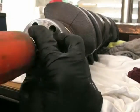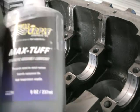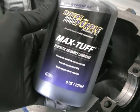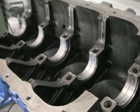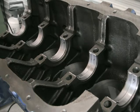At the end of the crank there's a little bearing — it's a 6001 bearing. You may as well change this one while you're in here. It's what the gearbox shaft sits in, and if it's not in good condition you can get a winding noise. I've chosen to use purple assembly lube — it's a very good lubricant.